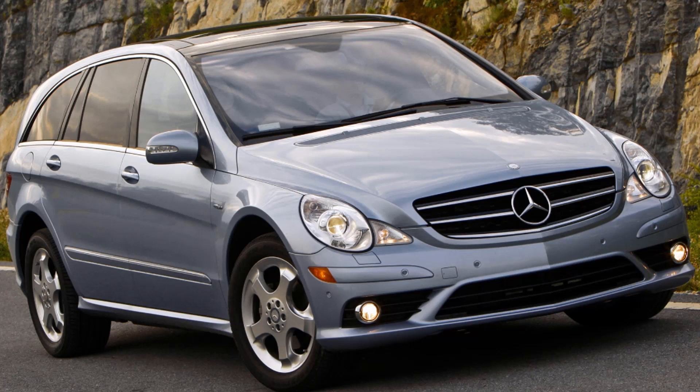This is not a black death video, but I will talk about black death. If you open the hood of a Mercedes that runs terrible, or it's hard to start, or it cranks and doesn't run, and the entire tops of the injectors are covered in black soot, and if it does run, maybe you hear what sounds like an exhaust leak at the top of the head — that is a black death engine with the injector seal leaking where it screws into the head, which is a copper compression washer. That's a different story.